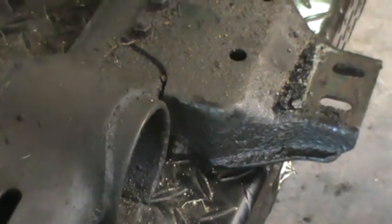Those are going to be a little more difficult. You're going to have to use a wrench on them because there's no way a socket will clear the hole for the exhaust pipe. So that's going to be 2 wrenches. And I think those are probably also 9/16. Yes, they are. They're kind of a loose 9/16, but a half I'm sure won't go on it. So that's it for the cross member for the transmission.